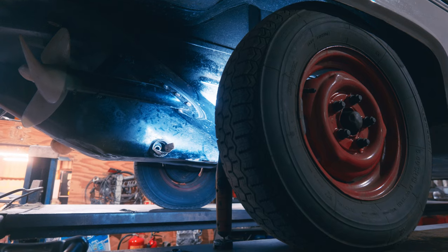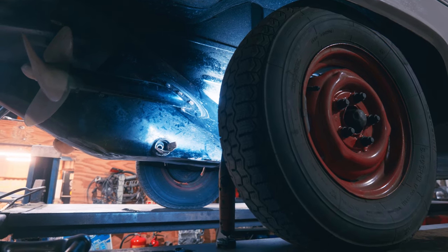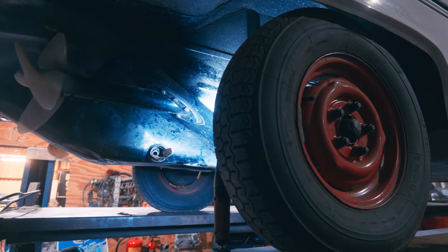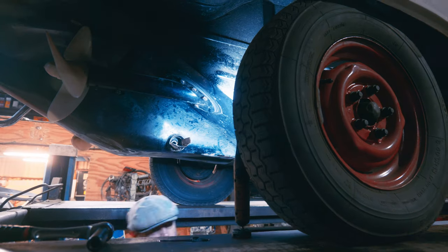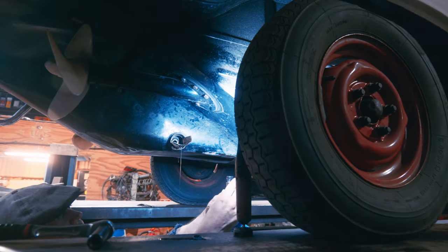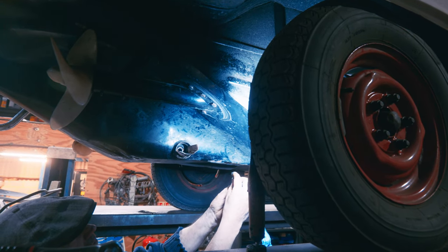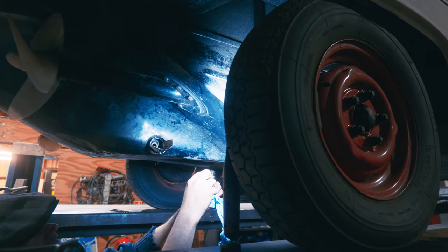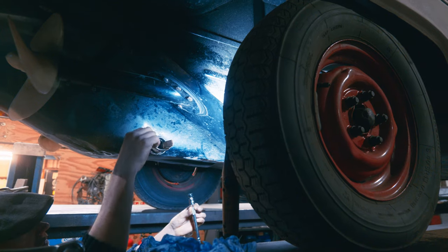That's the way I do it. On a modern car you seldom have oil leaks unless you've got an actual problem, so you don't want to be the one that's caused a problem since you serviced it. Just a smear of silicon sealant - any type will do, it doesn't matter what colour. I usually use black because it looks less unsightly down there.